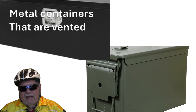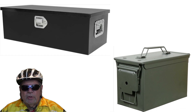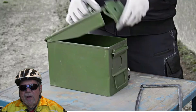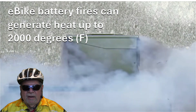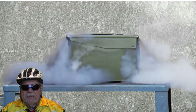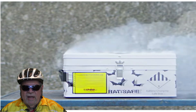The next items used to contain e-bike battery fires are steel metal containers, like an ammo can or steel toolboxes that are vented to allow expanding gases to escape. Keep in mind the exterior of these metal boxes can heat up to over a thousand degrees Fahrenheit, so make sure they're not on or around any combustible surfaces. You can also get a fireproof container made specifically for lithium-ion e-bike batteries — these work very well, but some fire can still escape, so they shouldn't be around combustibles either.